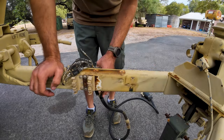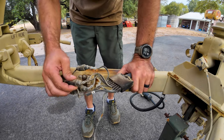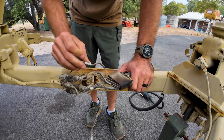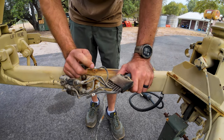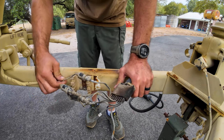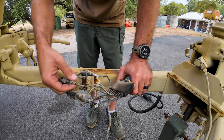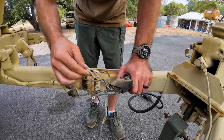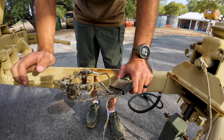What you're going to want to make sure of is before you start disconnecting all these connectors — if you didn't know, these are called Packard connectors. You can see all these little pieces of aluminum. Sometimes they get really covered in dirt or they've been painted over a bunch of times. There's numbers stamped on them — these are critical. There's numbers stamped on each side. Depending on the model trailer you have, there's going to be little variants. Ultimately, what you want to make sure is that on each one of the wire sets, on each side, they're readable. Then you can start disconnecting them.